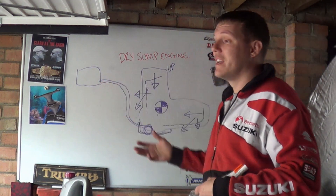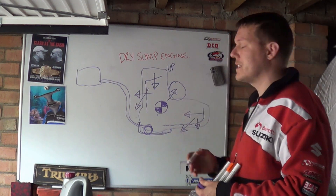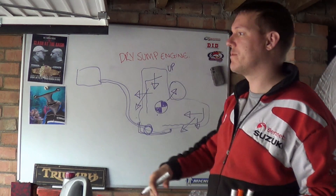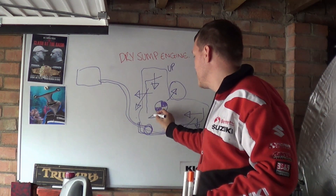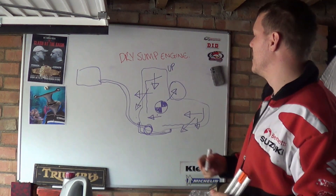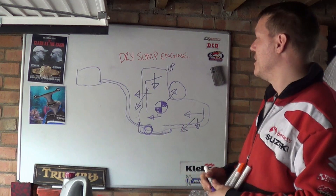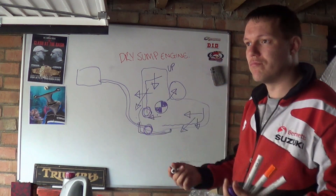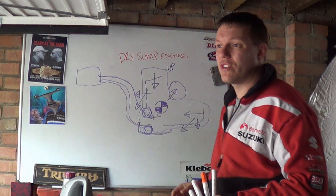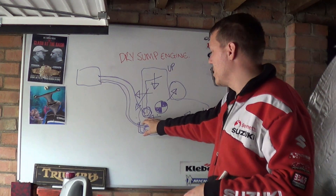You can have an oil line that goes from the engine up to the rear reservoir — basically shifting some of your weight rearward. It has to go somewhere. You wouldn't want to put your oil reservoir up high because that would shift your centre of mass upward, which defeats the whole point. Putting your oil and cooling reservoirs toward the rear shifts your centre of mass just a bit back — it's not a huge weight, but it does shift it towards the rear wheel, which is exactly what you want. Sometimes they also require a small electric precharge pump to send oil to the main pump.